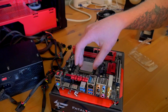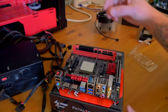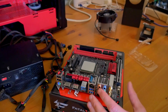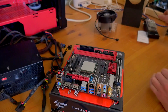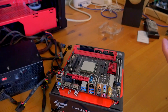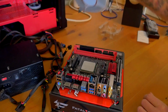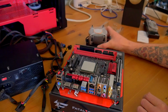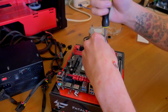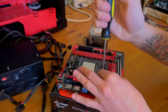Once it's set in, make sure it's actually seated. If you force the arm down and the pins are not seated, you can snap pins off and damage the CPU. It's a lot easier to damage Ryzen CPUs than Intel CPUs — which is probably also why Threadripper finally went LGA. Interestingly, the new Wraith coolers no longer have a clip-on mount, so I'll have to unscrew the stock bracket.